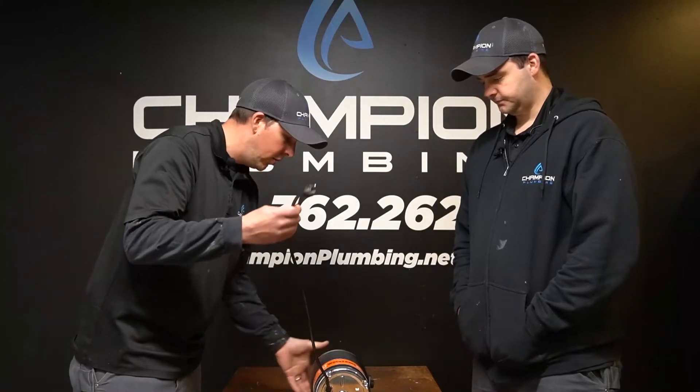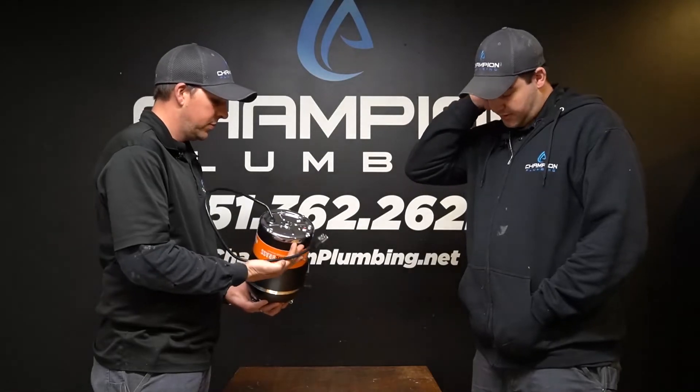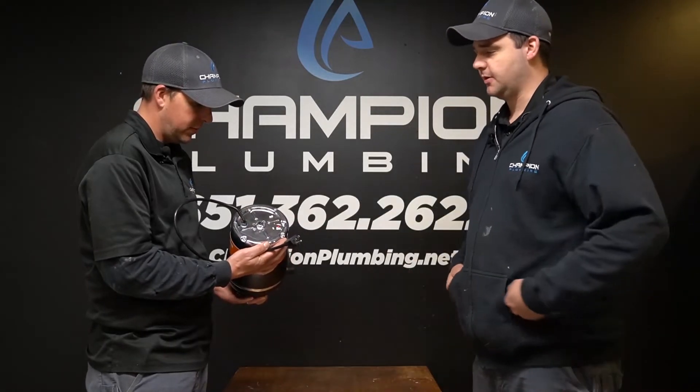I see there's an outlet here that you plugged into the wall, but I've been to houses where they're hardwired in — do we need to call an electrician? We don't have a different style for that. You can pull this cord out and that gives you access to the wires behind it, and we can connect the hardwired wires in the house directly to it. So just because ours has a cord doesn't mean it can't work hardwired in their home.